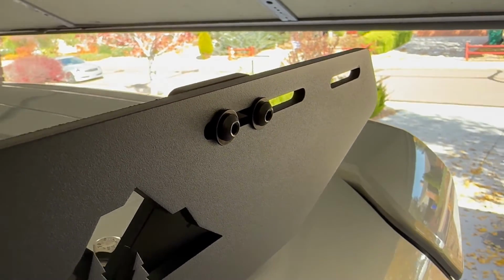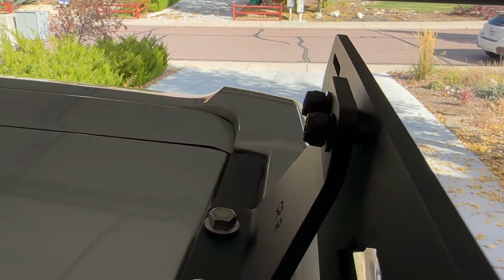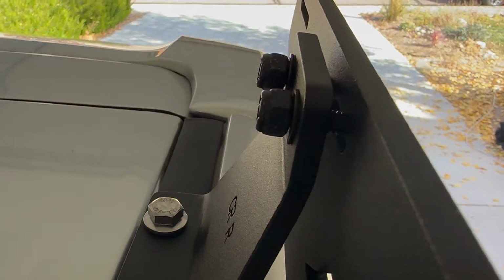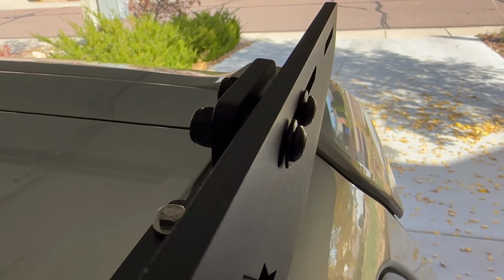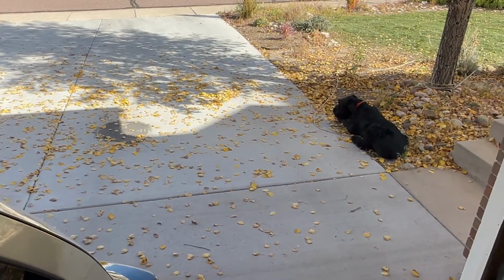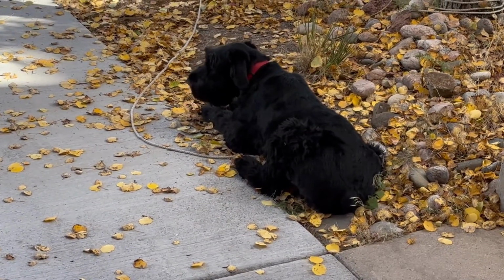Now for the fourth one. Here's some footage of the majority of the screws you will be dealing with. There's maybe about 40 of these, and Sherpa recommends hand tightening with an Allen wrench. Now I get it. They say hand tighten because you don't want to strip your screws. But power drills these days have adjustable torque settings, and they also have a variable speed setting based on how hard you press down on the power drill's button.